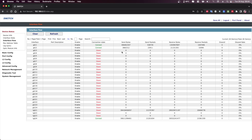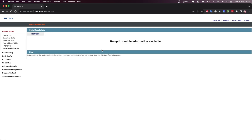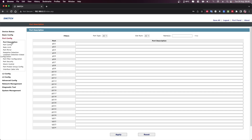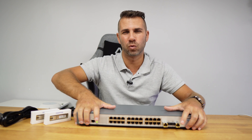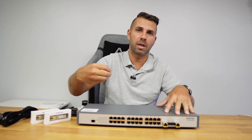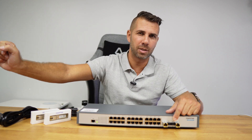There's also a MAC address table, VLANs, logs, and optic module info. In the basic configuration you can change the hostname and date/clock. The port description feature lets you assign a label to each port, which then appears in the interface status — very handy in an office with many machines, so you can identify exactly which port connects to which machine without accidentally disconnecting the wrong one.